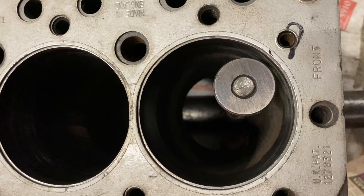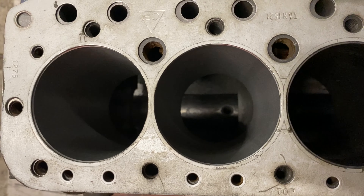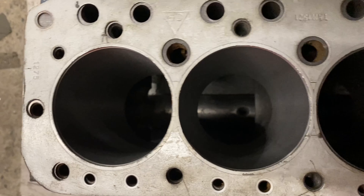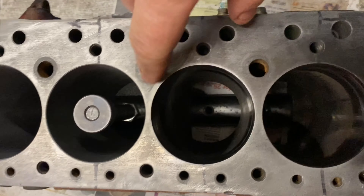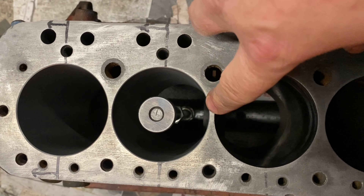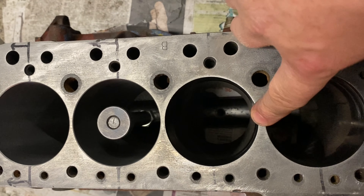That one might only need one offset. It's not normal to have the same offset on every cylinder. When you want to match a head gasket, you've got to start somewhere, machine the block, make the holes line up, and then machine to suit. I've had a measure here with the vernier and we've got about 136 thou thickness there.